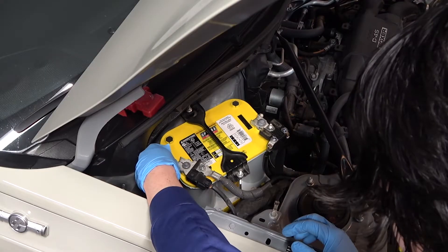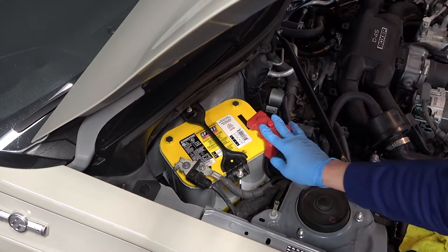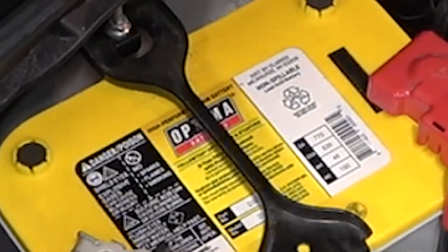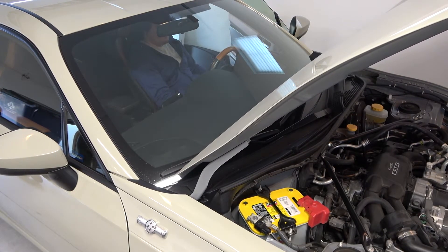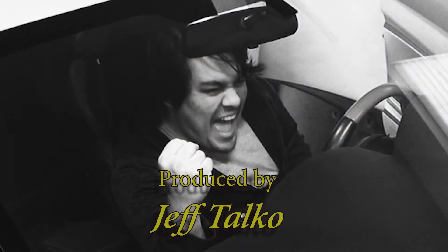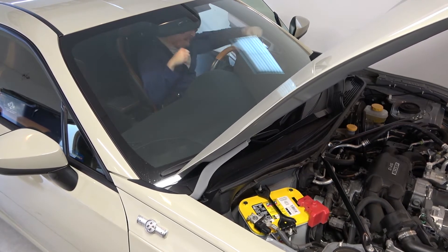Now that everything's snug, clean off your area and admire your new battery! The sense of accomplishment, the feeling of fulfillment, the excitement of doing something yourself — a pride in fixing your car! Now for the real test of every car DIY project: starting it up! Feel free to bust out your multimeter one more time to test the battery while starting the car and watch the level once your alternator gives it charge. It should drop to around 10 volts and then rise back up to 14, and settle between 13 and 14 while running. That's the sign of a healthy battery — now you can take it out for a drive!